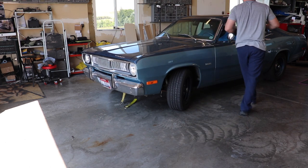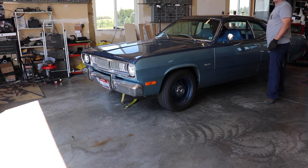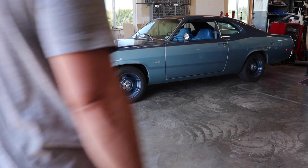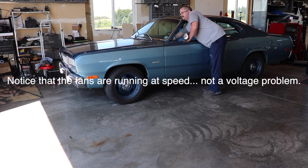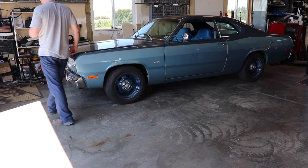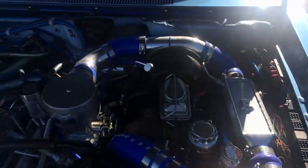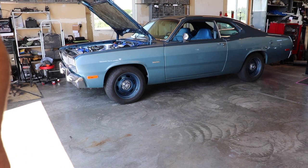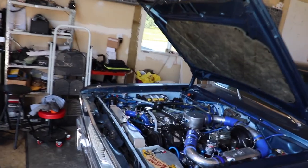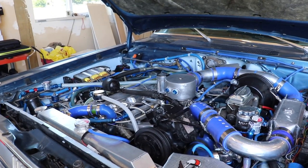Once the car cooled down, the starter could turn it a little bit at a time — an eighth or quarter turn. Way too high a load. Someone suggested a bad starter, but when I put a breaker bar on the crank and showed how difficult it was to turn, he agreed it probably wasn't the starter. Another factor that really showed this was an oil issue: right after it stalled on the side of the road, the only thing smoking — and smoking quite a bit — was the turbo. Losing oil to it means you lost both the cooling and the bearing lubrication for the turbo, and yeah, she was done.